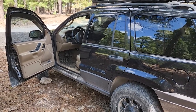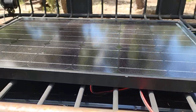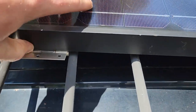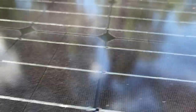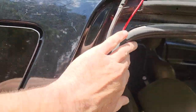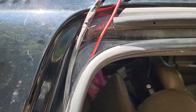Yes, sir — it started right up! So this is the second part of a solar briefcase where one half broke and shattered, so they let me keep it. That's just half of it and I had it laying around. It's a 60-watt panel, 18 volts — or it might be 12, I think it's 18. All I did was stick it up on the roof rack and zip-tied it down so it's nice and secure — it's not going to slide anywhere. Then I ran the wires just directly through the door weather stripping. If you're worried about leaks, feel free to run it any way you want, but this way I don't have to poke holes in the Jeep. I haven't had any issues with leaks so far, and it's a beater Jeep so I'm not too worried about it.